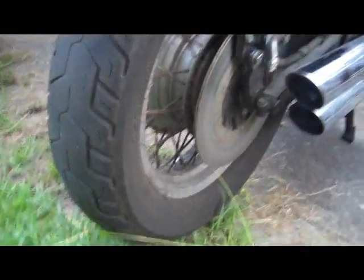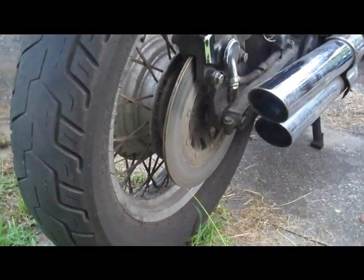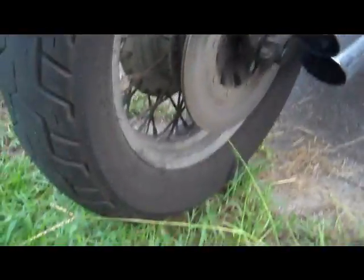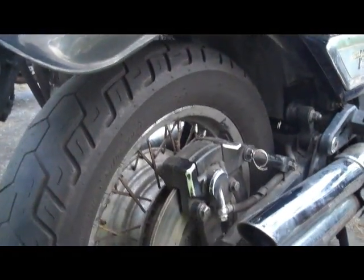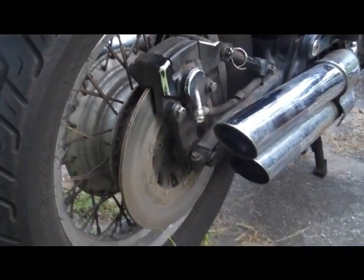As you can see, I'm going to be looking into that pretty soon with my bike because we're getting just down to the markers. But if you just bring them the wheel, then they'll throw it on, usually for pretty cheap. Another thing, you'll need to know how to do this when changing your bearings or inspecting your final drive if you've got a rear diff like I do, or any number of other things. So it's important to practice this and learn how to do it, especially on the road. I keep all the tools that I need to do this on me in my saddlebags, which are tied up there so you can see what I'm doing.